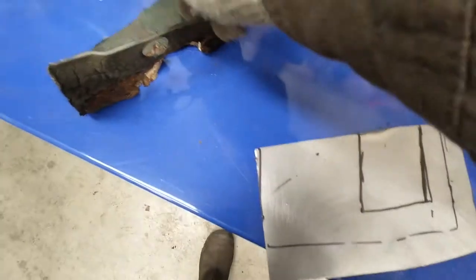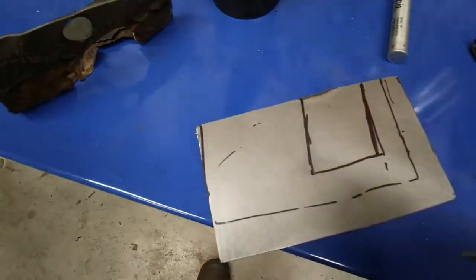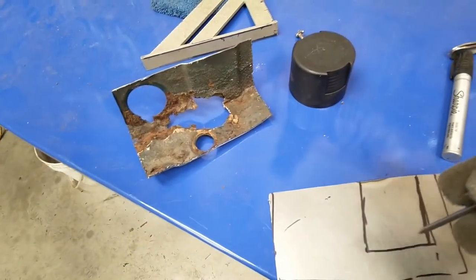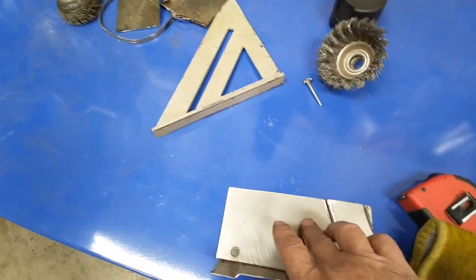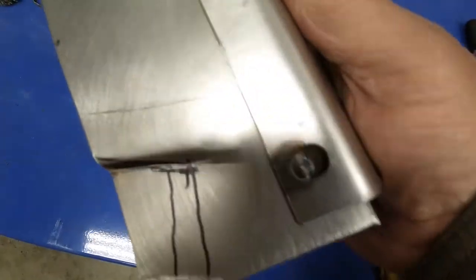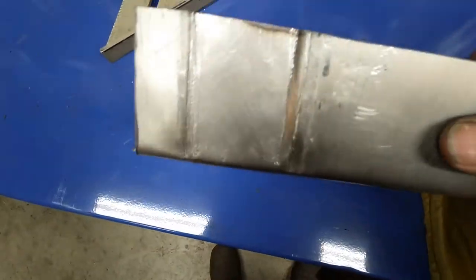Now to make this piece - you can see at the end here one is overlapping the other. The bottom of the trunk goes over, this part overlaps. So here's where the flange will be - this bit here that has the flange on it, the hoopie stuff on it. The hole will go around here somewhere but I'm not worried about that at this time. That's the way it sits in the car - this is towards the top, this would be the wall piece and that'll be the floor piece. So I made this piece up and I decided to weld them - just put a little tack weld in those spots to get it started because I wanted to make these hoopie things, one there, another one there, to fit into that spot.